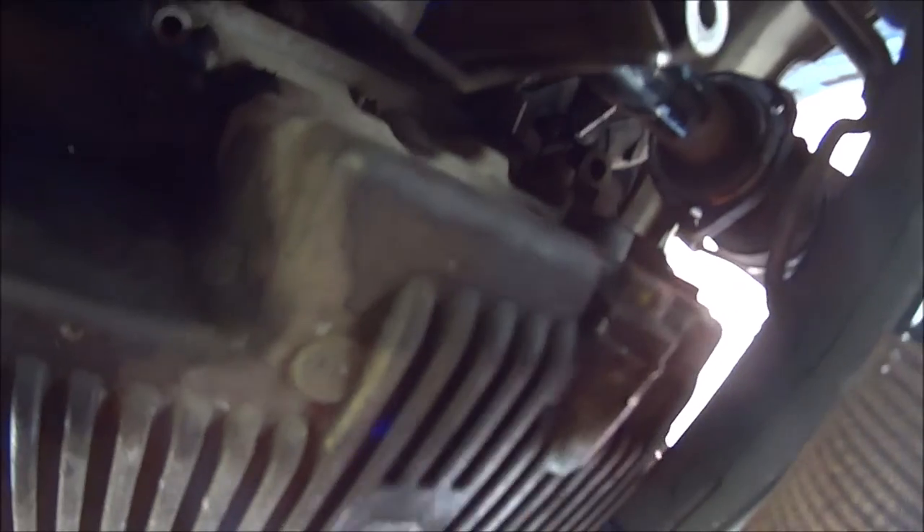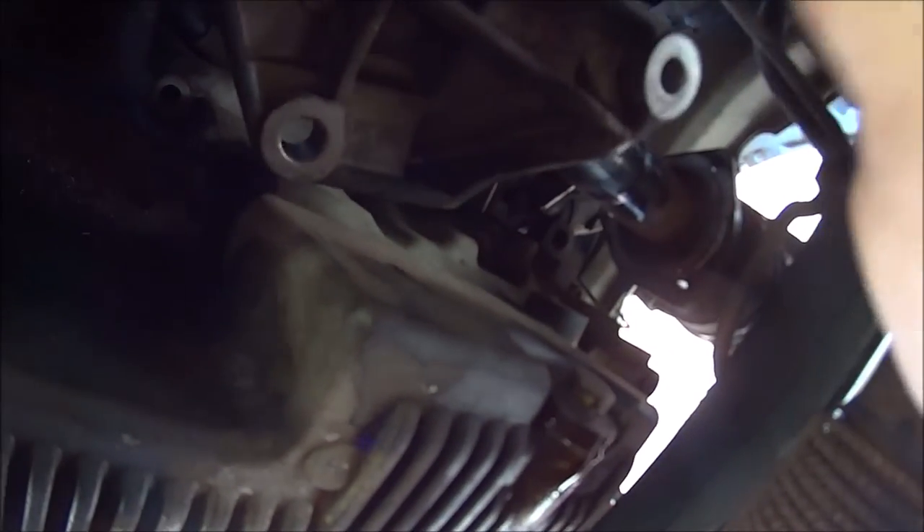You can actually get this sump out without taking the driveshaft completely out — just get this end done, pop it out of this end, and you'll have to undo the bolts on the front of this as well. There are two more bolts here, and one just here, and then one on the other side. I've managed to break this one undone with a 12mm socket, so I'll get all these bolts out and I'll be back when I've done that.